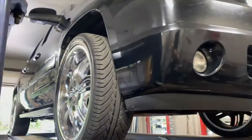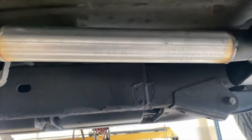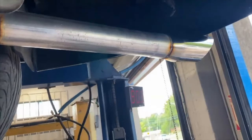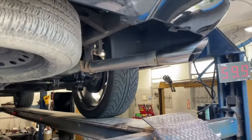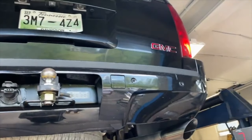2008 GMC Yukon — beautiful vehicle. What we got done on it: factory converters there and there, then it Y's into a single. Thank god it doesn't have that third cat. We cut off the stock muffler, put three-inch pipe in its place and a Flowmaster Super 10 — link will be in the description. We also cut the resonator off and put a four-inch pipe and a four-inch angle-cut tip. It's a Yukon XL with the 5.3 in it.